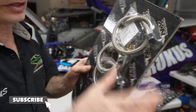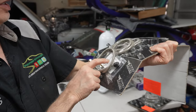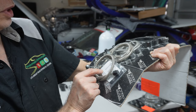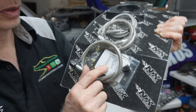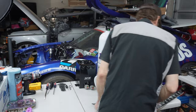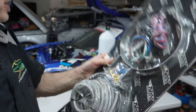Then you've got your three lines and your fittings — these are your nozzles, your jets. 78 millimeter for the throttle body. The power range goes from anywhere from 50 to 350 horsepower. This kit includes 200, 250, 300, and 350 horsepower jets, and I believe you've also got the smaller ones available. There's also some extra line included.